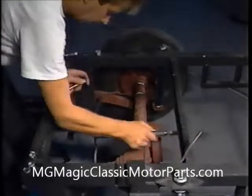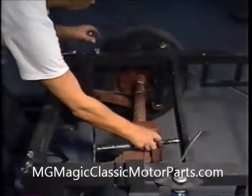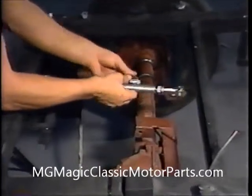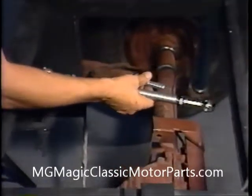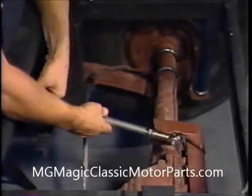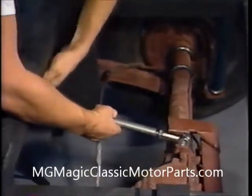In order to install the adjustable rear link, we first thread the jam nuts, then the rod ends onto the threaded rear link rod. Once the rod ends are in place, we secure the front rod end to the mount, located on the chassis, with a 1/2" diameter by 2.5" long grade 5 bolt with 3 flat washers, a lock washer, and nut. Normally, we prefer to use a lock nut in place of a lock washer for this particular application.